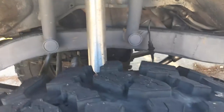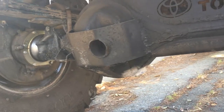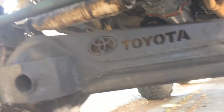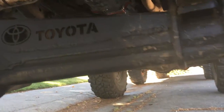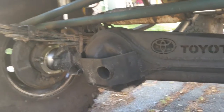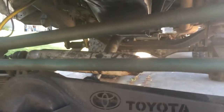Biggest billet stands you can buy. I need to skid my front axle — some rock damage on that. I'm gonna be plating the whole underneath of the diff with some three-eighths inch plate, and then the underneath of the axle all the way across. I have a pretty cool gusset that I'm gonna be making for the front that ties onto the diff cover — it's gonna be sick, one of a kind for sure.